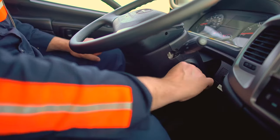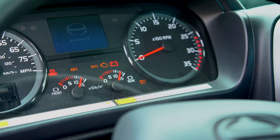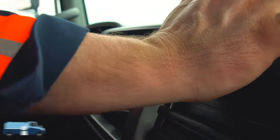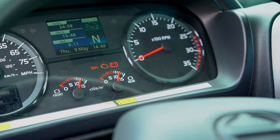Once it has kicked off we will shut the truck off and then turn it back into the on position. All the lights will pop on on the dashboard to show you it is on. We're going to release the air brake and then press and hold while watching the gauge to make sure it doesn't drop more than 3 psi in a matter of a minute.